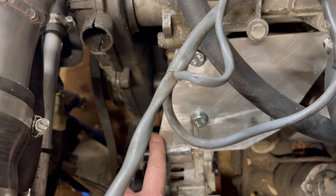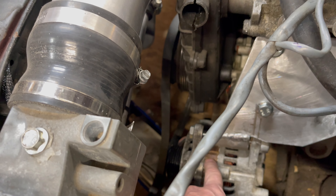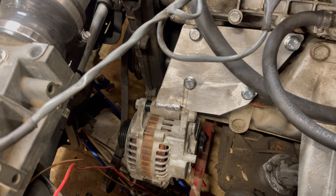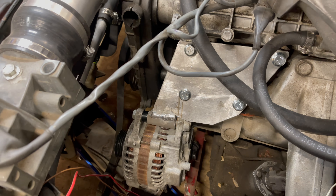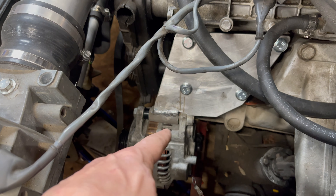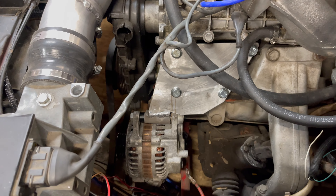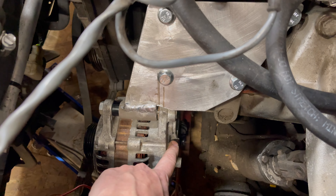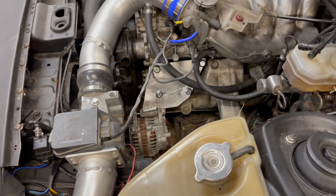I'm going to have to reinforce it with some stiffening. But I've got to get that old power steering belt off, and I've got a bunch of belts to try on this to see where I land. Once I know I'm all lined up, I'll take this out and do the reinforcing so this doesn't bend - it's just aluminum, not super thick. But that's going to give us a low-mount alternator with 100 amps, and it cleans up the bay a lot.